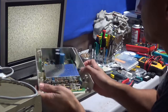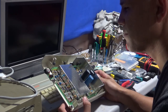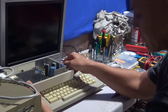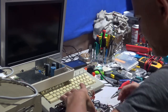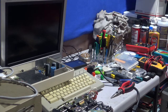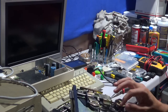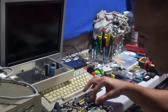Let me shut off the computer and have a quick look at the motherboard. For some reason this motor here seems to be stuck. I could try to swap it with another one because I have another drive that's bad - I have it right here. I believe that one has a bad head. You see how I can push and move this head on the second drive? I can't do that on this one - it seems to be stuck.